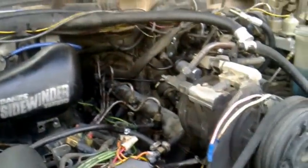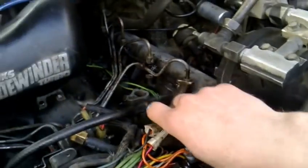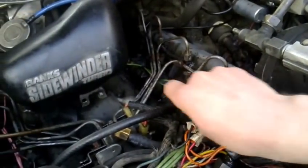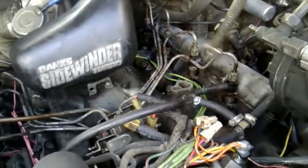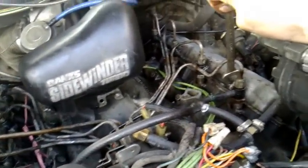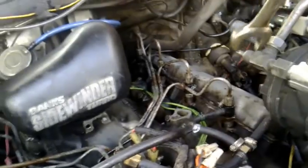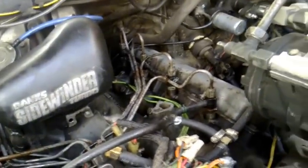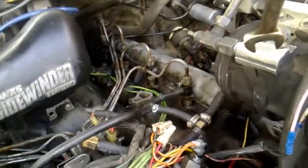First thing to do is make sure you've got your 5/8 wrench, and you want the end that is on the injector to be just an eighth of a turn from tight. So it's just loose a little bit. Fuel will build up and come out right around the top here because it's not tight. So we're going to crank the engine over and watch for fuel. When we see fuel come out, we tighten that cylinder.